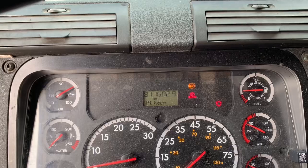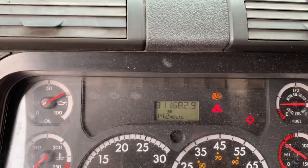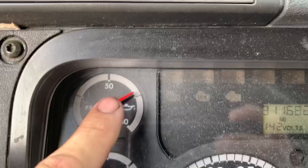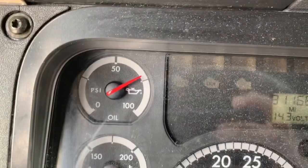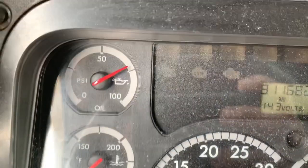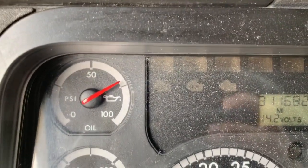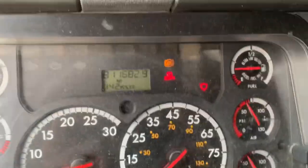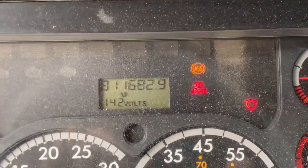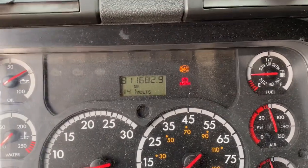Good morning everybody. Today we started up the DD-15, this is a 2009-2010. We replaced the oil module, the seals on the module, the seals on the tubes — and look at your oil pressure now. What a difference. When we first started it before doing any work on it, you were at 50 PSI, and now we are just under 75. That's the way it needs to look on a cold start. As it warms up, the oil will get thinner and the pressure will drop — completely normal. What I like to show you is look at the difference when you first start up in the mornings. That tells you if oil pressure is kind of low — be careful. This truck has 811,000 miles on it. Hopefully it'll have another quarter million, depending on how it's taken care of. I'm excited — it's all done. Hope you have a good day. Thank you for watching.